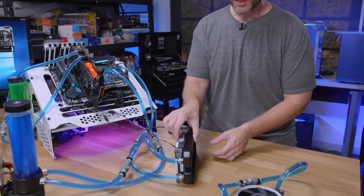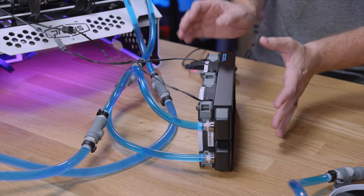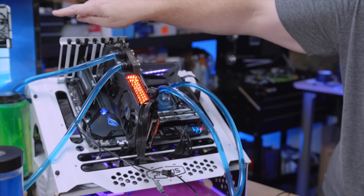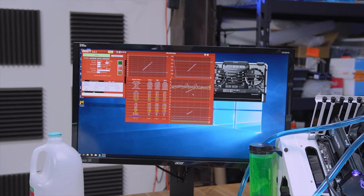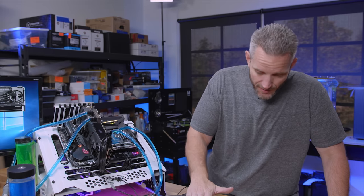We're going to start off with our baseline test using the standard dual-pass radiator. I'm also using two Corsair SP120 Quiet Edition fans, maxed at 1,200 RPM running at 100%, because we're testing the full cooling capability and thermal capacity of these radiators. Right now I'm running just the 8700K in the loop. We're going to let the temperature and the fluid temp equalize using OCCT medium data sets. The CPU is technically not overclocked, but it has a sync-all-cores setting, meaning all cores run at the turbo clock — a slight overclock in that all cores are allowed to ramp up. We'll let the temperatures equalize, then hook up the GPU, and that will be our baseline with the standard dual-pass radiator.